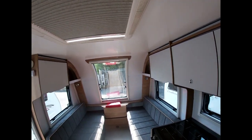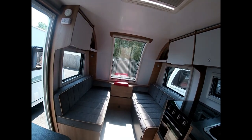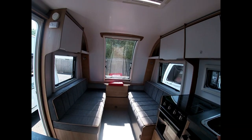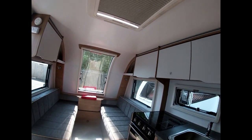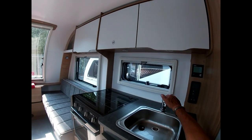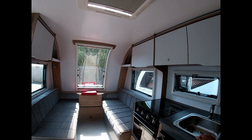So there we go. One last thing to discuss just before we go, and that is winterization of your caravan. Really, really important, especially in those winter months. I tend to get into the habit of it straight away when the clocks change. We want to drain everything down, because if it freezes, the risk to your van water system is quite immense. As we've seen looking around, the taps look domesticated, but they're actually only plastic. They're plastic fittings, push fittings and plastic pipework. Water freezes, it expands. When it expands, it splits and cracks.